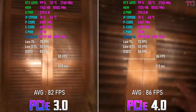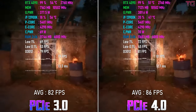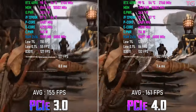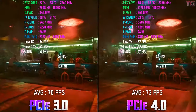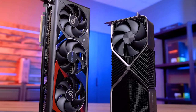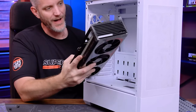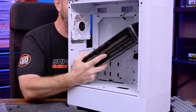And of course, let's talk a bit about the PCIe connector itself, into which you insert this card. There are plenty of videos on YouTube demonstrating that even the RTX 4090 is more than happy with the 3.0 bus. Switching to 4.0 gives only a few extra frames per second. However, you need to understand that this is really true only in the case of top-end cards that have a huge amount of VRAM. In this case, only data necessary for the game to run is transmitted through this bus, and there are no issues.